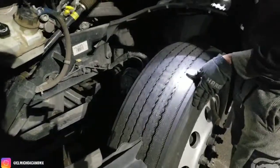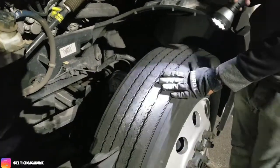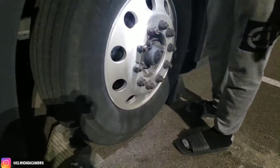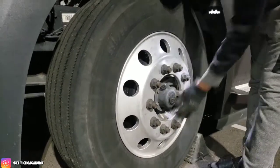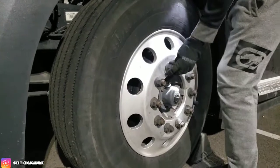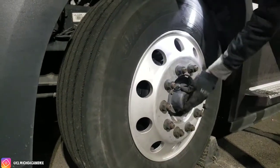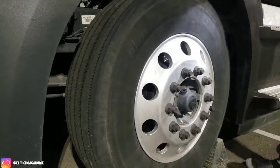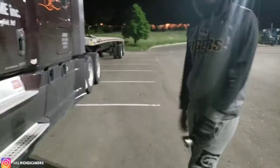Check the brake drum: properly secured, in the back over here. Properly secured, no cracks, not broken. On top of the brake drum you've got the brake lining: properly secured, no cracks, not broken, no oil or debris, friction material is not worn. Check the steering tire: properly secured, no abrasion, no cuts to the tread or the sidewall. Tread depth is 4/32nds of an inch per manufacturer specification. Check rim: properly secured, no cracks, not broken. Check lug nuts: properly secured, no cracks, not broken, none missing, no rust trail. Check hub seal: properly secured, no cracks, not broken, not leaking, per manufacturer specification.